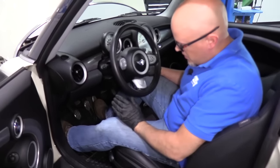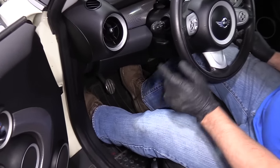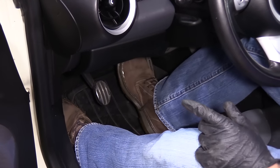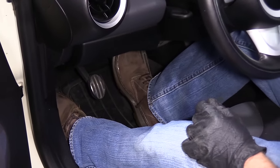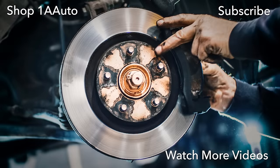After we're done the brake job, we're going to want to pump the brake pedal, because there's a little bit of an air gap between the caliper piston and the brake pads, so to eliminate that air gap, just pump the brake pedal. Thanks for watching — visit us at 1AAuto.com for quality auto parts, fast and free shipping, and the best customer service in the industry.